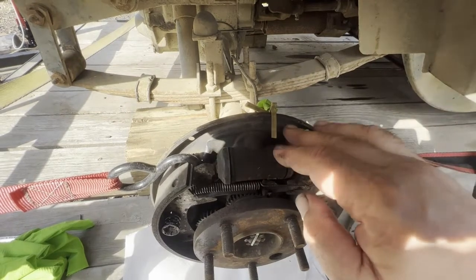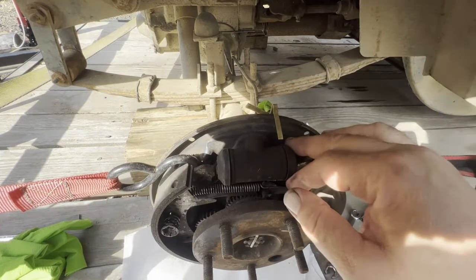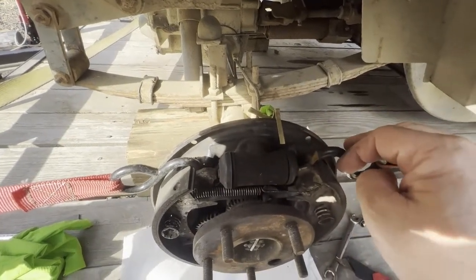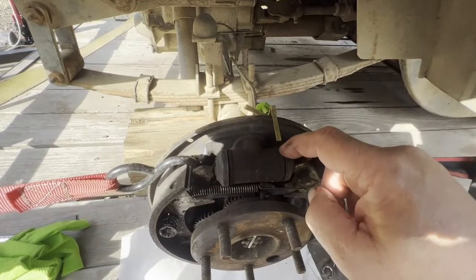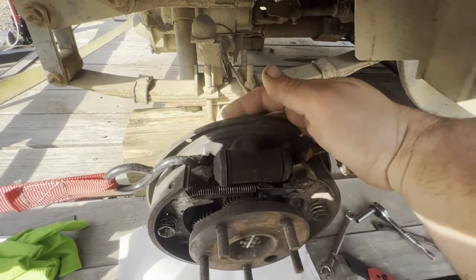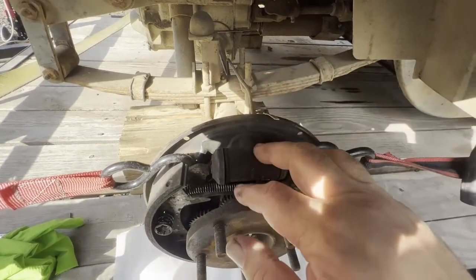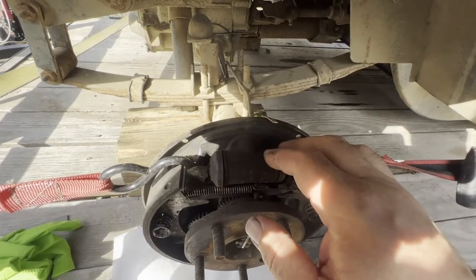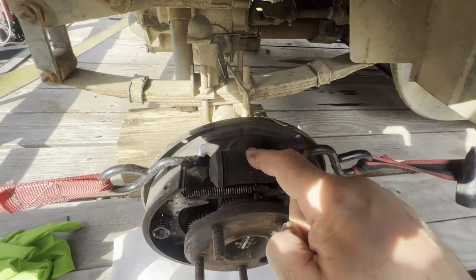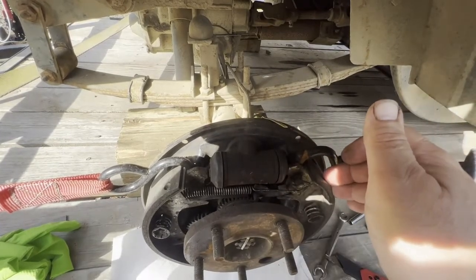The cylinders should be in later today — that's pretty straightforward, and there are plenty of videos on how to replace those. But I just wanted to give you a heads up: if you do a project like this and find that you have perfectly good pressure coming out of your bleeder screw but still little to no braking, go ahead and replace your wheel cylinder and scuff up your drum to reseat the shoes, especially if they're glazed.